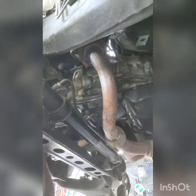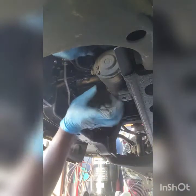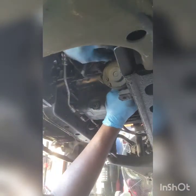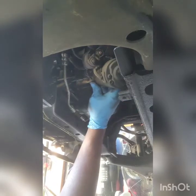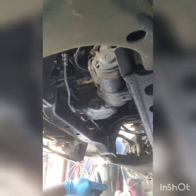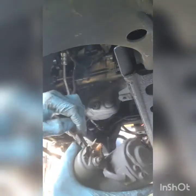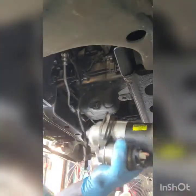Once that happens, slide back to the front and have it hanging right there. Now we've got to disconnect the power cable — right here where it's hanging is the power line. There's a rubber boot, you peel it back, it looks like a 12mm, so take that out of the way. Remove the cable. Once the cable comes down, then we have the small wire for the solenoid — it just disconnects. And the starter is out. That quick, easy and simple.